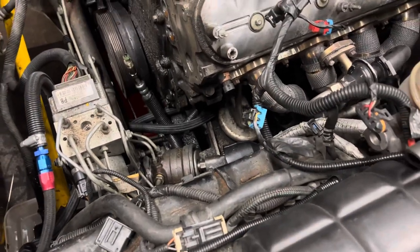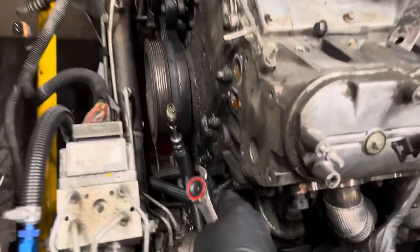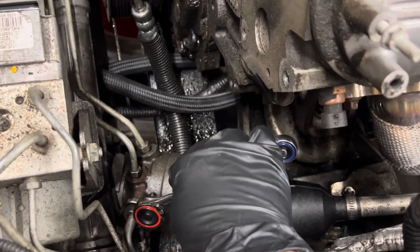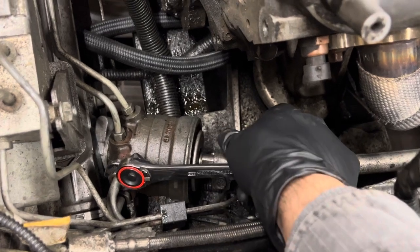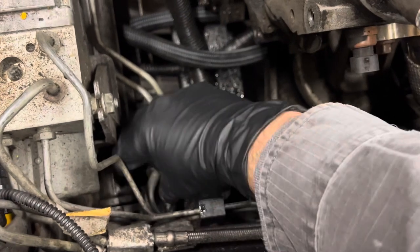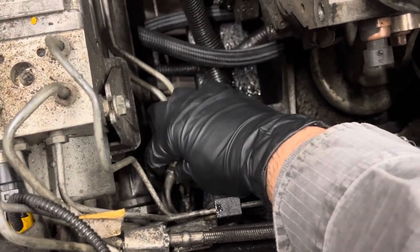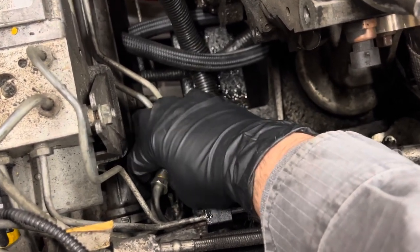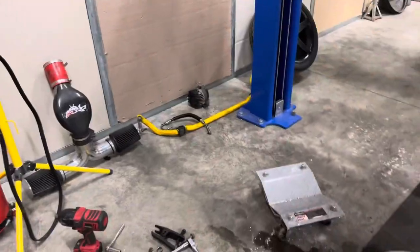Normally this is hard to show but since I have everything out of the way it's pretty easy. It's normally 18 millimeter but if you use a crow's foot it comes off a lot easier. In tight quarters that kind of stuff is perfect — get yourself a crow's foot set, I'll put a link to mine in the description. I took the water pump out, took the steering rack out, and took the sway bar out to do the steering rack. Once the sway bar comes out it's easier with the water pump out — I slid the rack over, turned it a couple times, and it slides out.